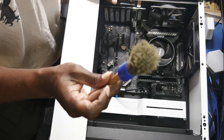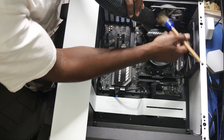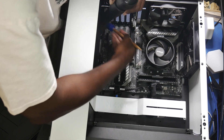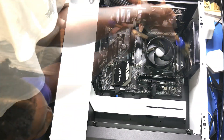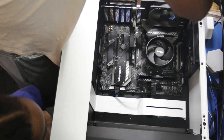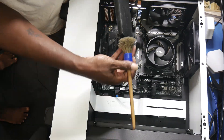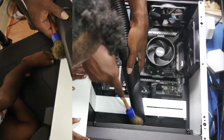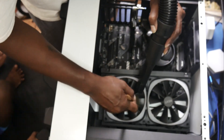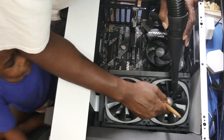I'm going to move the computer to a better position and I'm going to be using one of my detail brushes and a vacuum. This is going to let me break up some of these big dust particles and keep them from going everywhere in the air. I'm using the brush to work all the fine areas that I can get to, making sure I can break up as much of this dust as possible. Now I'm going to remove these front fans so I can clean that area as well.